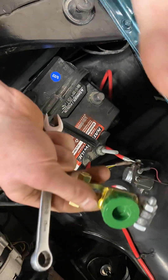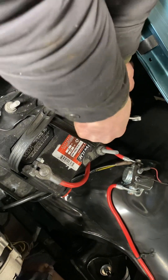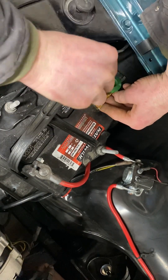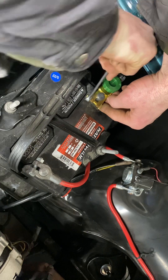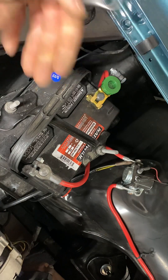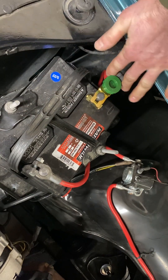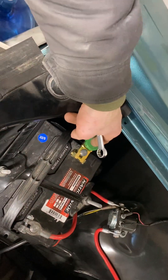With this loose, there should be no power to the electrical system of the car right now. Now we're going to put the battery cable on here — just like so — take the 13 millimeter wrench and tighten this side up. You can hand spin it first and then tighten it up. Once tightened, it's not going to move at all. This center piece is going to turn because there's a little spacer in there, but it's not going to damage it at all.